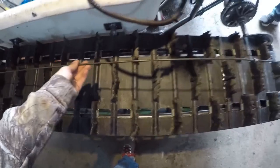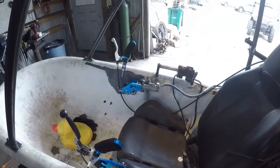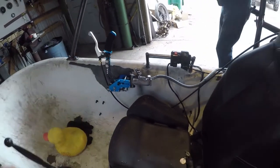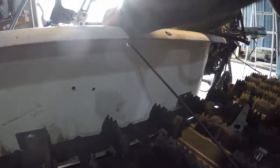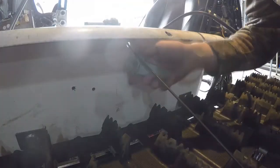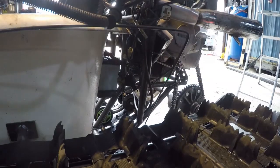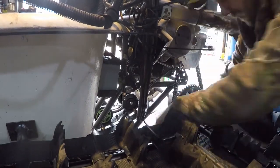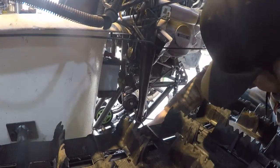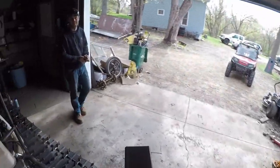This is it — this is the final-ish piece. We've got a brake line with the correct fittings. This thing was leaking like a sieve yesterday, so hopefully that'll solve our problems. We've got brake pressure on this side, that one's ready to go. This other side we've still got to get sorted. Let's turn this thing around — we're ready to give it its first run, we've got brake pressure.